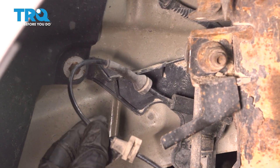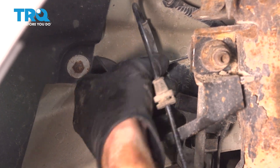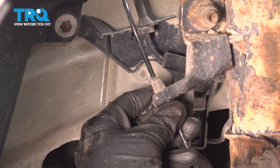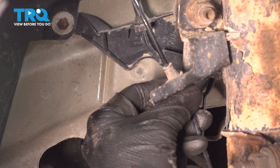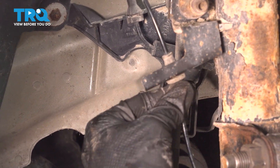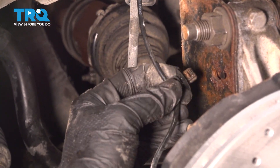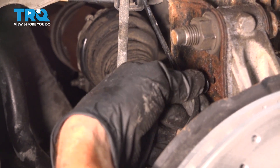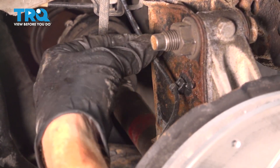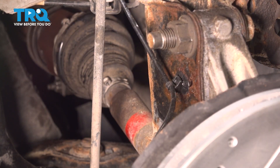It's time for the ABS wire — we'll start securing this. Start at the upper mounting point, line it up and press it in. A quick tug along the way. Moving along to our metal bracket, slide that in as well. Now let's follow this down to its connection point on the strut — it's going to slide right into this port. Just press it in as far as possible. Double check confirming it's completely secured — you do not want this getting damaged while you're driving down the road.